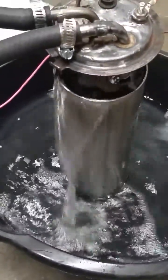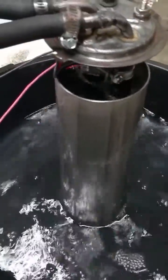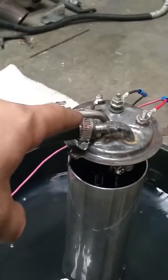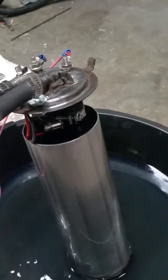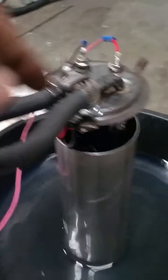That's a lot of fuel. That's not coming from the fuel pump — that's coming from the fuel going out and then returning back from the engine, going through that little tiny jet pump I showed you earlier. The jet pump creates suction on that little pipe right there and sucks fuel out of the fuel tank.